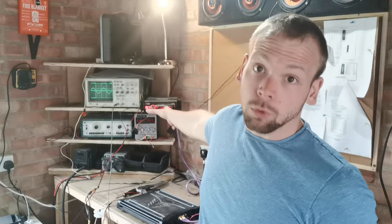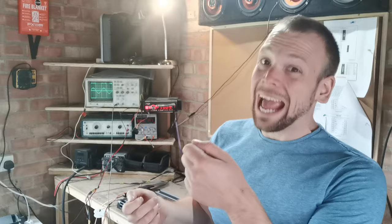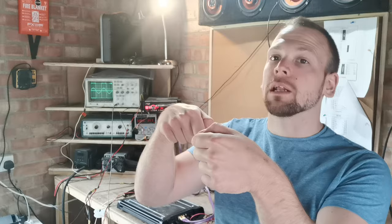So here's a quick recap and run through. Get a pen. Find your head unit online. Look at what the pre-out voltage is. Get your settings to where you want them. Turn the volume up until you've got your pre-out voltage on the other end of your RCA. So you want to put the black probe from your multimeter, on AC voltage, on the shield, the red probe on the little pin in the middle, until you get the right voltage. Then plug it into your amp.